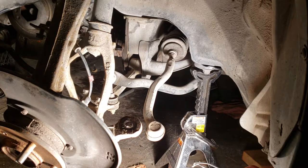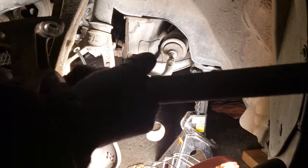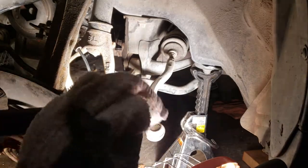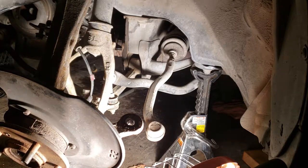I'm gonna give you a quick video here for the driver's side CV axle. The tough part about this job — well, they're okay, they're easy, but it just takes time. You just have to have the right angle to put the CV axle in. There's that half shaft right here with the bracket that bolts to the back of the block, and this side goes into the transmission. Make sure this thing is clean and where the seal rides — make sure that's clean.